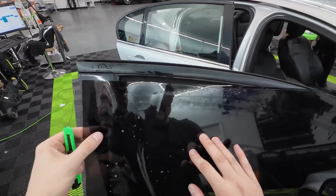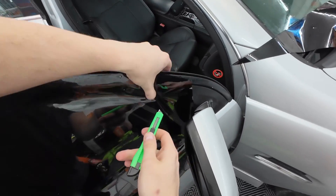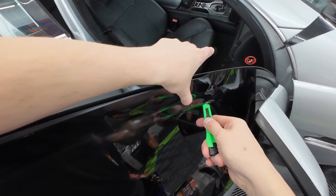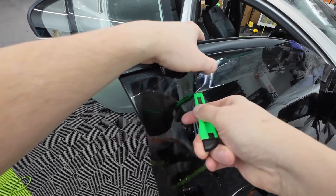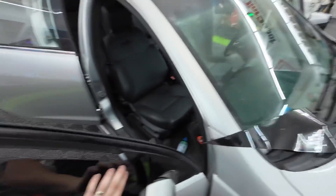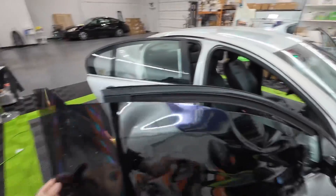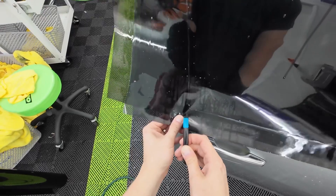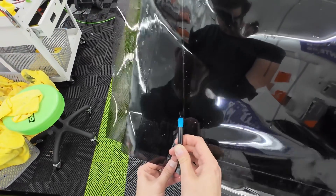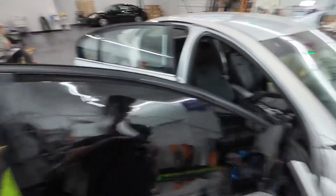And again, we want to be really careful. It's not sliding as much — that's good. Just be extra firm. The more surface area that you can tack these together, the less anything is going to slide on you. Poke that in. Top edge knife, all the way across. Beautiful. So now we have three cuts to make with the snitty. Cut number one can be anywhere, so let's just start here on the side. There's my line — we're going to go straight up, just keep this outside that line, all the way up. Boom, that's cut number one.